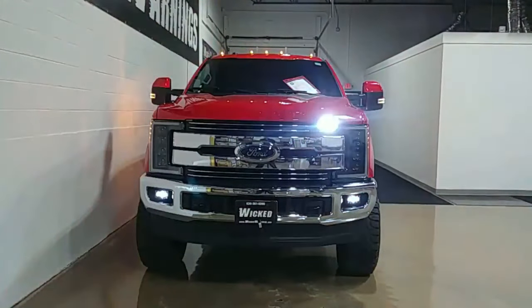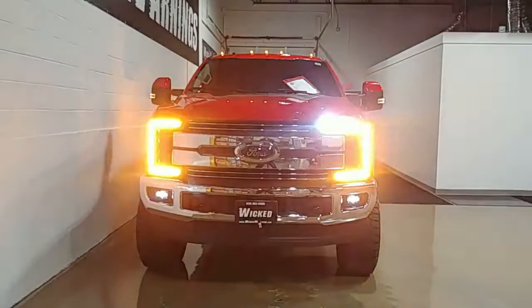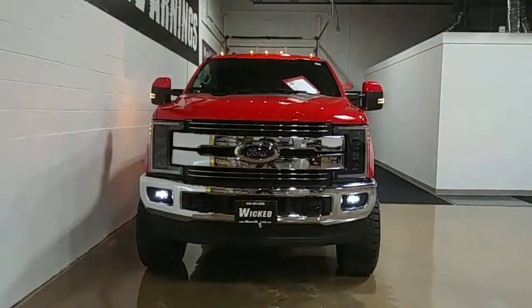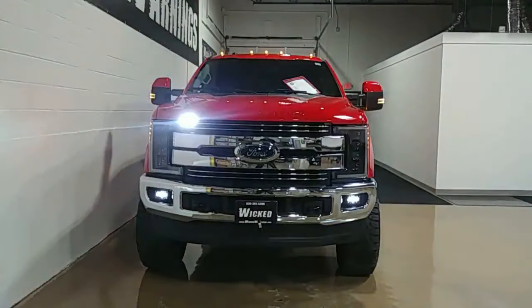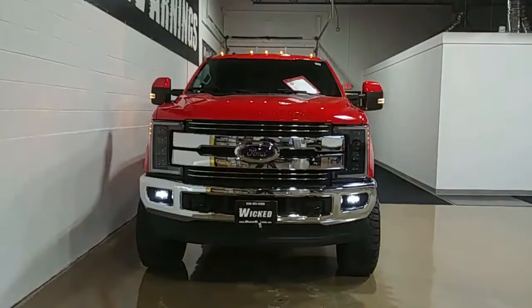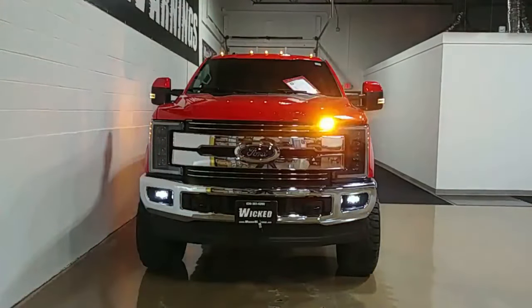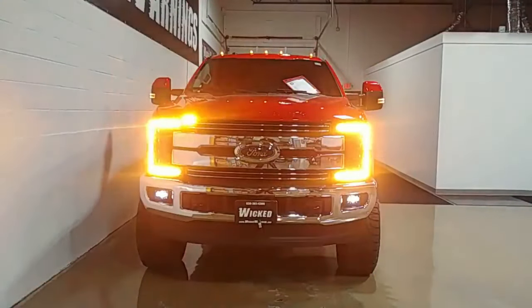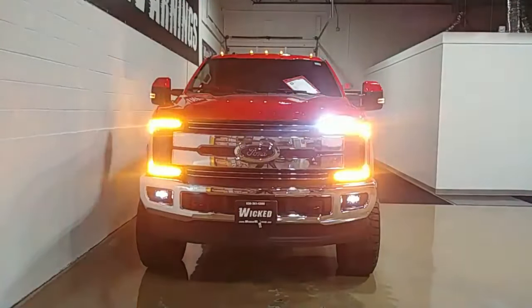We also have right below that a Morimoto fog light upgrade — the full LED fog light upgrade as well. Now, because this truck was lifted, both headlights and fog lights needed to be aimed. Out of the box I had to dip the headlights down — your results may vary, but don't forget to aim them. Right next to them in the upper corners, you'll see a SoundOff MPower 3-inch amber white. It's tight up in the corner of the grille, about as high and wide as you can get, and nicely protected by the grille itself. We chose an inter-cycle pattern with one of the lights being on the alternate color. That's all we did for the forward warning on this particular truck.